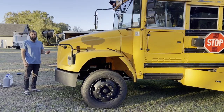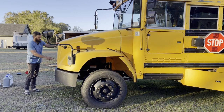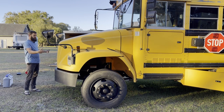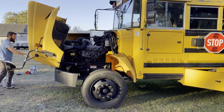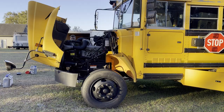One of the common things with these Freightliners, according to a friend of mine, Eli, is that there's a connector down here, a crossbar, that causes this entire structure to break. It's the spring lever that helps you open this easier. In my case, you have to hop up here and muscle it. But by not having that bar in there, you don't have the issue of the spring-loaded bracket actually breaking your entire hood.